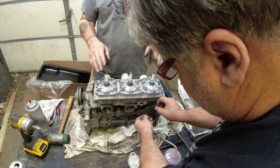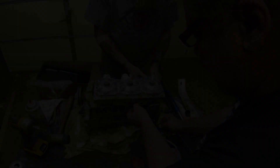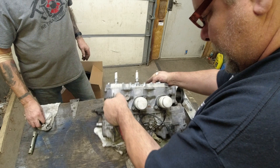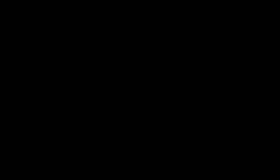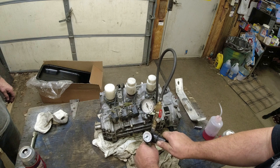Alright, so we're getting ready to pressure check. Spark plugs are in, we've got plugs in the carb boots, and we're doing this with a rubber gasket on each port. We've got our block-off plates with thick rubber gaskets on all the exhaust ports, tightened down. Spark plugs are tightened down. Lonnie tightened down the carburetor plugs. I'm going to tilt the motor back for easier viewing. We're going to put our pressure check gauge on the impulse port, with the pressure regulator backed all the way off before we start. I've got the ball valve open and I'm going to wind this thing up to 12-14 PSI - not more than about 14.